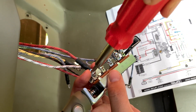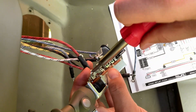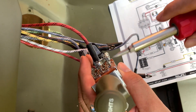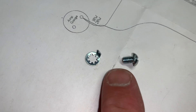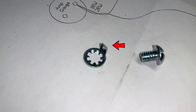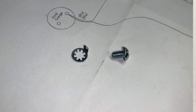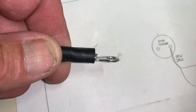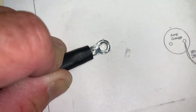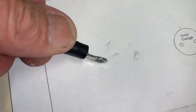The red wire with the two black tracers — I'll call them black dots — connects to the SS post on the switch. This circuit is for the trailer socket. Keep the connections at a 90-degree angle to the switch. The fastener is a simple round-headed screw with a special star washer that has a little leg going into the hole directly underneath the screw terminal. The common connections on each end of the wire favor one side, so make sure you connect it the correct way or the screw won't tighten correctly.